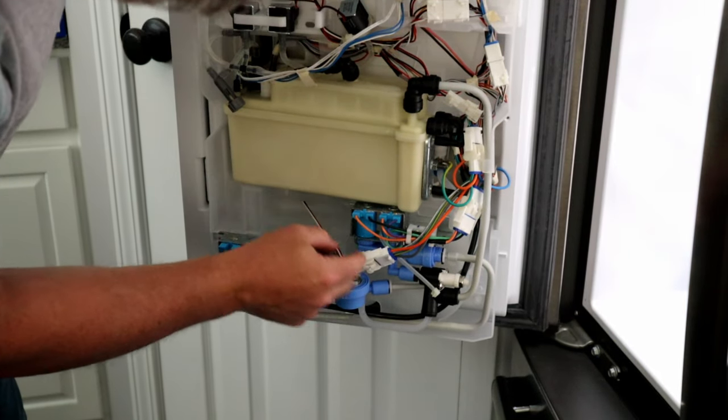Just for giggles, we'll hit start heating again — we're still at 80%. That's the great thing: once you get a tank full of water in there and it's already heated, it stays there a while. That styrofoam helps it stay heated, especially when everything else is cool inside the refrigerator and freezer. Also, about the dual-wattage heating element — if the compressor is running, to not contend with that, it actually uses the low wattage heating element. So if you're in a cooling cycle, it may take longer to actually heat your water. I'm calling this one fixed.